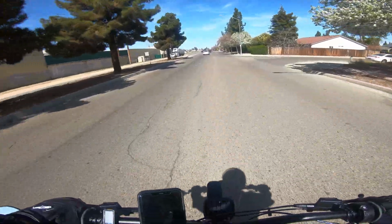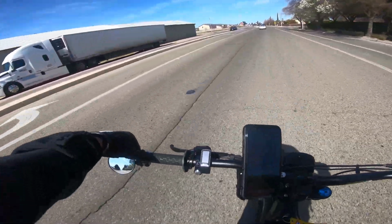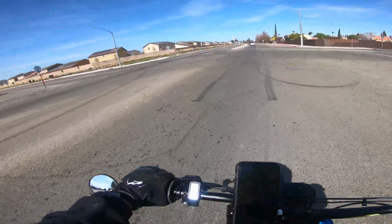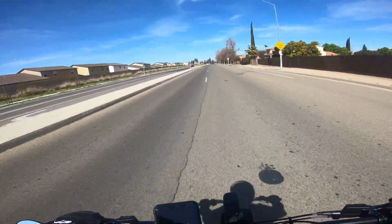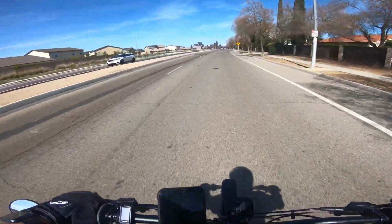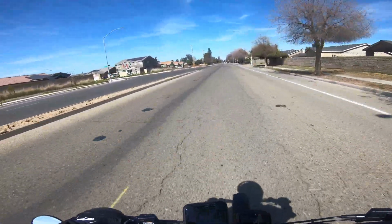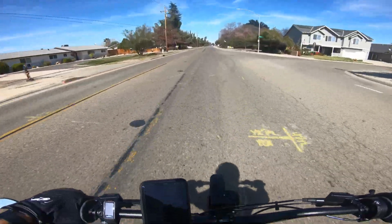It's going to drain the battery pretty fast, especially if you're on 8,500 watts. Everyone knows if you're on stock, you're about 4,800 watts, I believe, on the stock battery, pulling about 80 amps. And I was getting roughly, when I calculated it, I want to say average about 35 miles. And then when I rode with my buddy with his Super 73, we had to stay at about 25 miles an hour the whole time. And I want to say I did about 15 miles. And I had 71% battery left. And that was with the BAC4000, but I was also in eco mode.